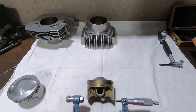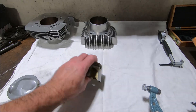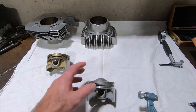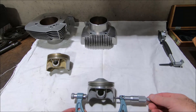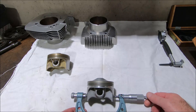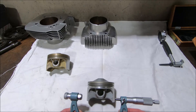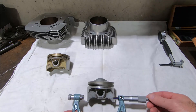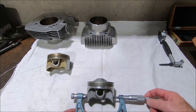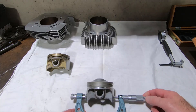I'll call this one 87.96, so it would appear to be a little bit undersized. Whereas the B piston should be a little bit bigger — 87.975. Well, at least this one knows what it's meant to be. Happy — at least someone here's a team player.